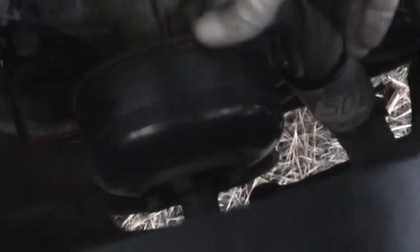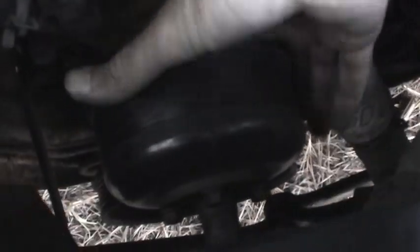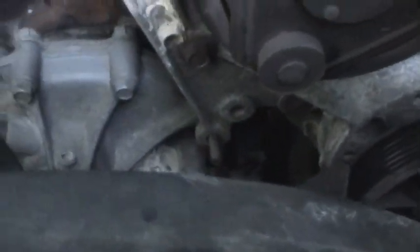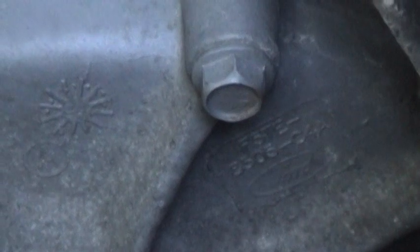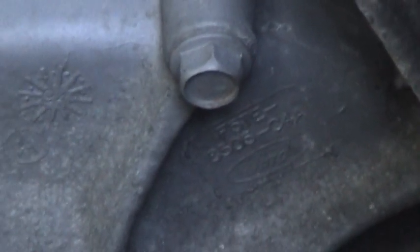And finally, here's the water pump. That's hard to spin too because it's got this big fan attached to it, but it actually spins fairly nicely. I'm going to grab onto one of these fan blades and try to move it around — and I can't. So those water pump bearings are in good shape, which is really amazing because that's the original 1994 Ford water pump on this thing.